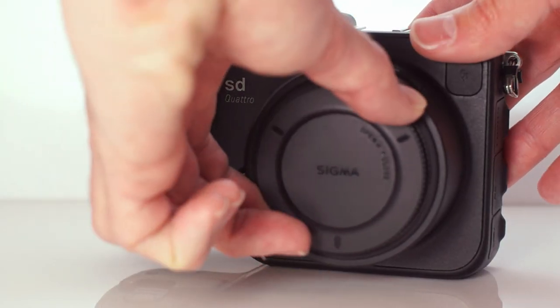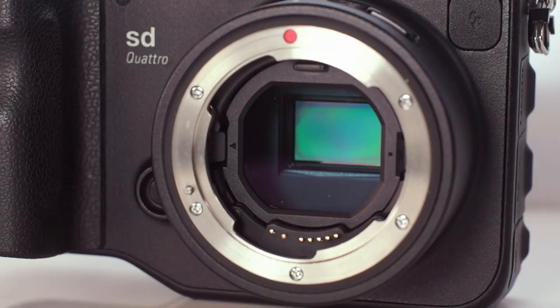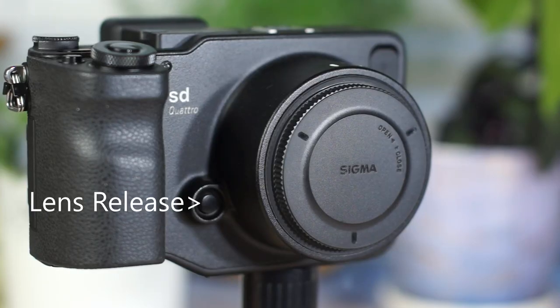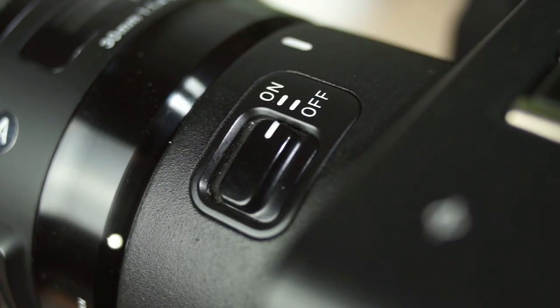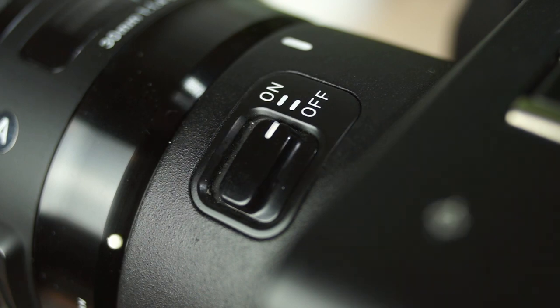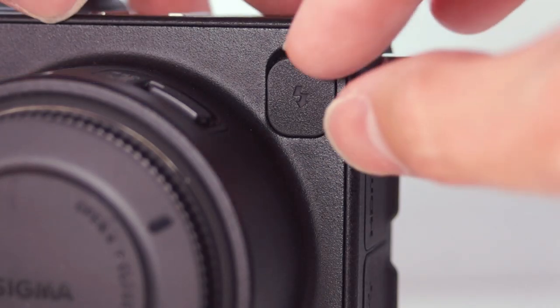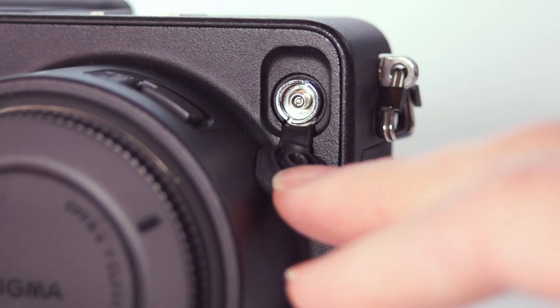Here in the front, after removing the cap, we can see the removable IR filter that protects the sensor. Usually the IR filter is on the sensor itself, but not so much with Foveon cameras — this actually makes them great for IR photography, as you don't need to irreparably modify the sensor. The filter is a little tricky to remove with just your fingers, but pretty easy with a pair of tweezers. On the front you also see the lens release button and the power switch. While this is about as odd a place for a power switch as it gets, I've never had any issues with accidentally turning it off. Here's the PC port for studio strobes — given that this camera is most comfortable in a studio environment, it is great to see a still-useful legacy port like this.